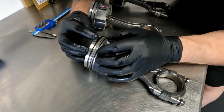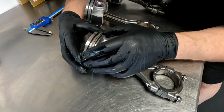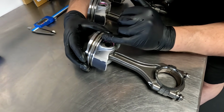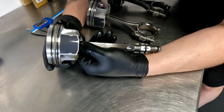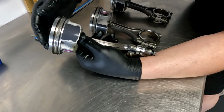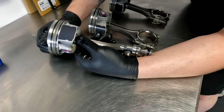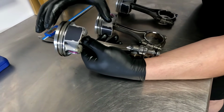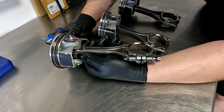The weaker pistons normally have ring packs which are fairly close, and I can see that the control ring as well, the oil control ring, is definitely the newer kind of 3-piece ring, new technology. Yeah, they look like a great piston, almost like a slipper piston, because there's very narrow thrust surfaces on this engine, so there's not much friction and losses through the skirt of the piston. A more conventional piston will be a lot wider around the skirt, give it more stability. But yeah, they are definitely looking like a very modern piston.